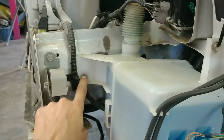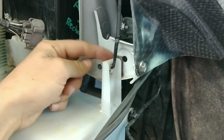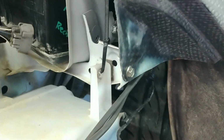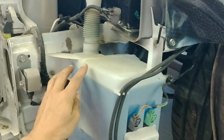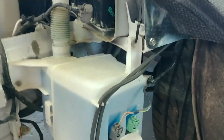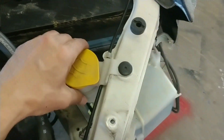I'm going to go ahead and drill a hole into the side of the frame here. Then I'll put a riv nut in there, and that way I can put some hardware in here. I've got it zip tied to the actual bezel for the fender bracket here. I'm just going to make a nice little L bracket with a stud that comes off, and then I can throw a little nut on here, and that will be stationary. But I've actually got it to where it flexes perfectly. This normally came down over here, but with just enough room, I was able to put it in front of this bracket and then move it forward. It does want to fly back a little bit, but it's really not too bad, and it's pretty stationary, pretty rigid, and it still goes up to the OEM placement.